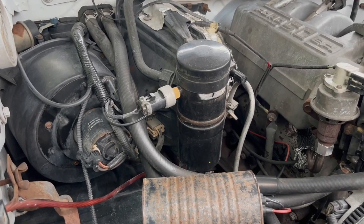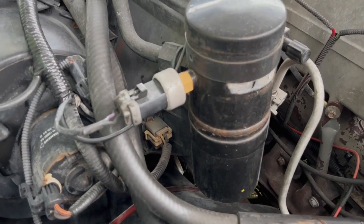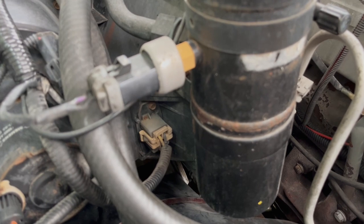Your blower motor resistor is located on the HVAC unit under the hood, kind of tucked away under the AC accumulator, but it's got two 8-millimeter headed screws and then it just basically falls off. Don't drop those screws on the ground — or do, make your own story. Drop the screws, drive over them, pop a tire. That's never happened to me before. The fan switch is probably not our issue here — this little guy is notorious for going bad.